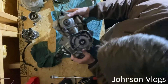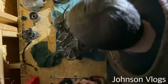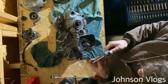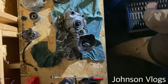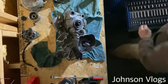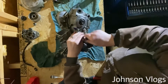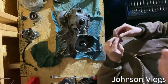There are two more 8mm bolts — one right here and one right here. I'm going to remove those because I'm pretty sure they go to the other side, but I'm not 100% sure — we're taking them out anyway just in case. There are some 8mm bolts on the other side of the motor, but I feel like those don't go through the case — I think they're just holding on some guards that go to the transmission. I could be wrong, but for now I'm not going to take them out. I'll start trying to split the case and see what happens. If it resists, I'll remove them.